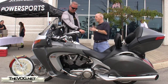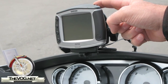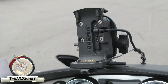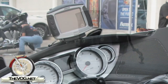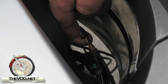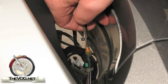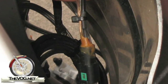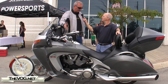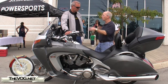I noticed that you have done a number of homebrew mods. The first one, which we've read about online, is your Garmin Zumo GPS. How did you rig that up? I went online and purchased a Ram ball mount that I mounted right here on the dash, and just used the Ram connectors that came with the Zumo in the motorcycle kit. I then ran my wiring down the dash, drilled a hole, put a grommet in there, and ran all the wiring underneath the dash to the factory connector off the main wiring harness. That's a connector made by a company called Tyco — it's a mini-amp 7-pin connector. They're inexpensive to buy online, and it provides your 12-volt power and audio for your speakers. So if you're listening to your stereo and directions come on, it just cuts out the stereo and gives you directions through your speakers, just like a factory install.